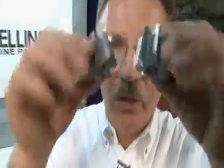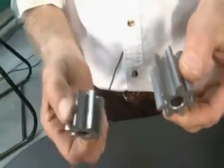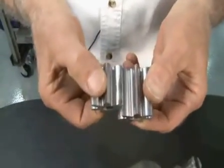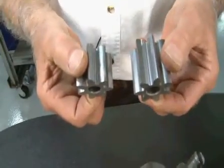These are the two gears out of the Chevy pumps. We've got the one inch, five hundred thousandths, and the one inch, two hundred thousandths. It's real obvious to see the length difference in the gears, and it's that length that produces the difference in volume — the difference between a standard volume and a high volume pump.